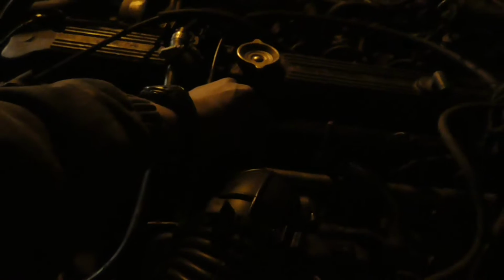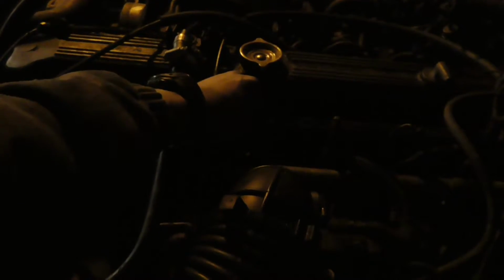But, did I not turn my headlights off? Again? This thing does have the same headlights my green Jeep does. You turn them on and then turn the headlights off. The headlights stay on for 30 seconds or so. But, remember how I wasn't holding pressure in the fuel rail? Holding pressure now. And this has been off for a good over 30 seconds. So I just got to figure out that leak, and I think that leak's actually on the return line.